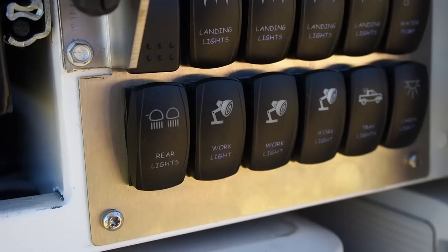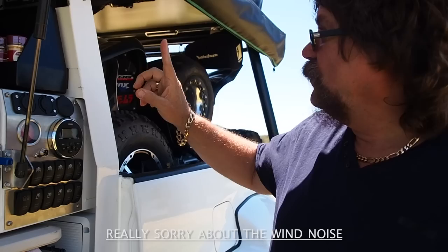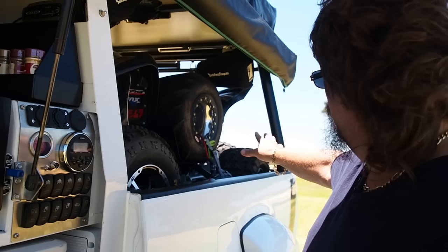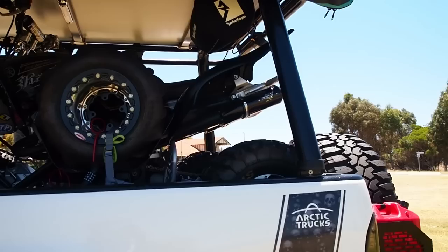All you need for lighting: I've got three lights — two in the kitchen for cooking, one over the gas bottles — then a set of three tray lights underneath the tray, and a dimming LED cabin light in the tent when it's up. We tried to keep the system as compact and as low as possible. Because of the speakers I was unable to get the quad out, so what we did was install two actuators on the back poles — this comes up over half a metre, so the system works around the speakers.